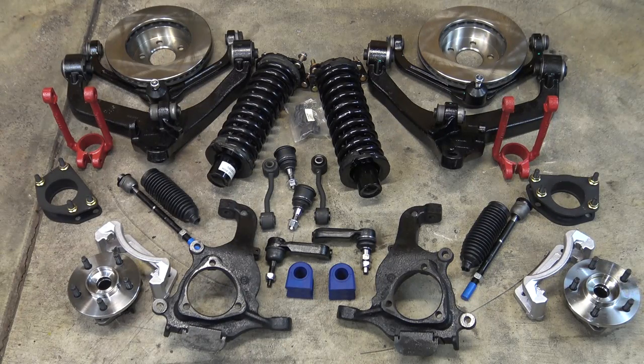In that episode, we pulled out all of the old suspension and cleaned everything up and painted everything that we kept. We also did the pinch weld mod, which is just taking a hammer and folding over the pinch weld. The only parts that we kept were the calipers and the axles.